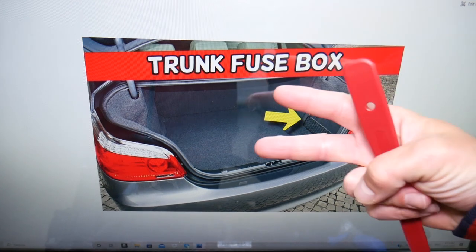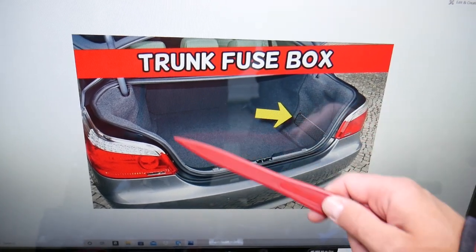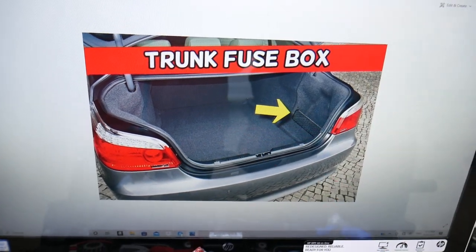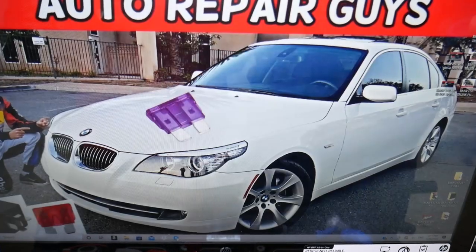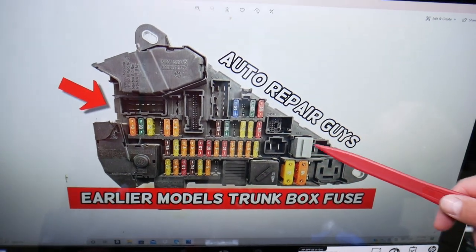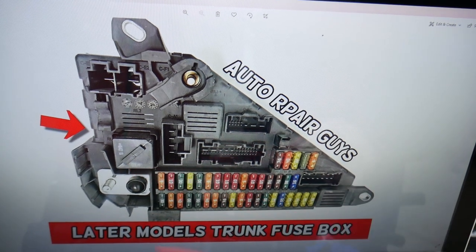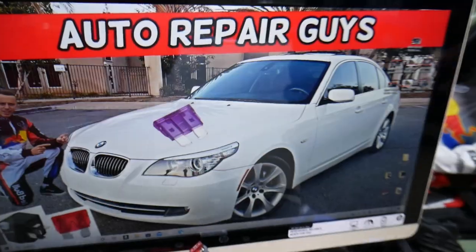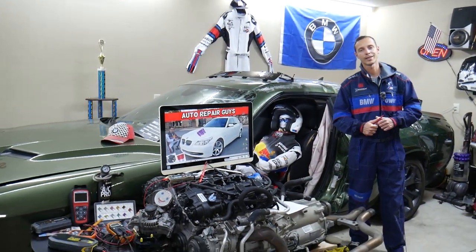In the trunk, there are two places where you can have a relay: one is under the cover where the fuse box is, and one is under the cargo liner right under the spare tire — you may have a plate with relays there as well. Under that cover you'll have a fuse box that looks different depending on whether you have the pre-facelifted version, and you may have one or two relays there. Some of you will have a fuel pump relay, some will not. Hopefully this video is helpful — thank you for watching, see you next time.